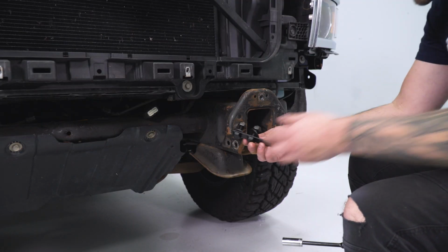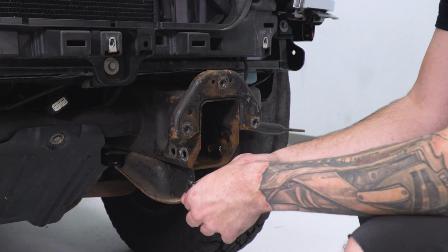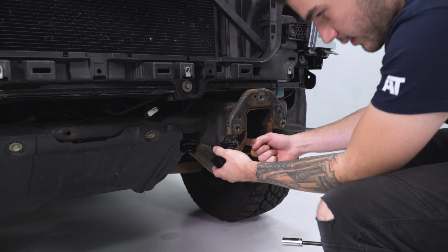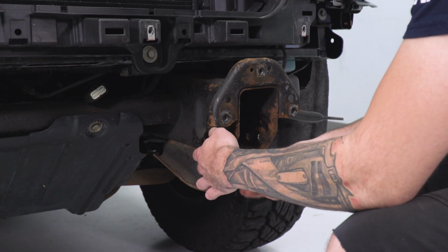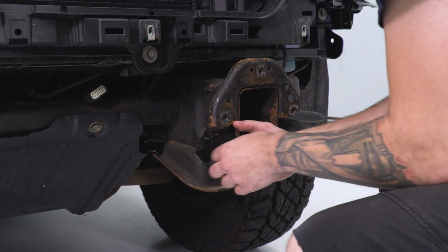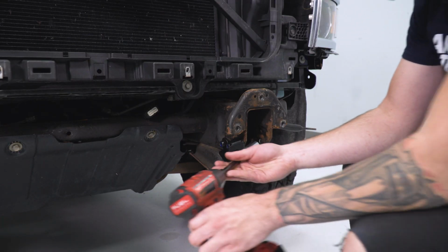And we have that double nut bolt plate. We're gonna take off our nylon lock nuts. We're gonna use spacers as well. You're gonna put the double bolt plate with the longer piece on the inside, going straight through just like this, and that will hold up our support bracket. On the opposite end, we're gonna use our washers and our lock nuts. Grab your 19mm socket and tighten those down.